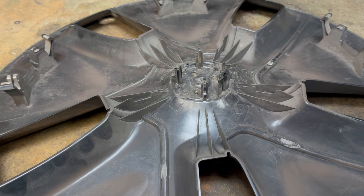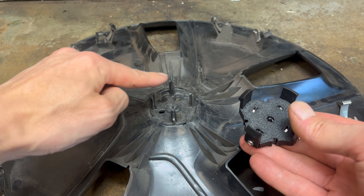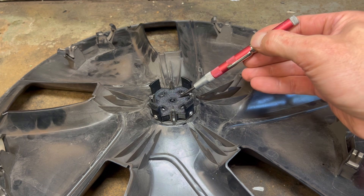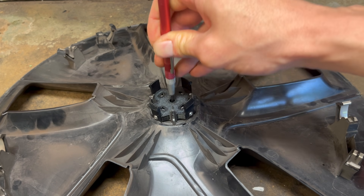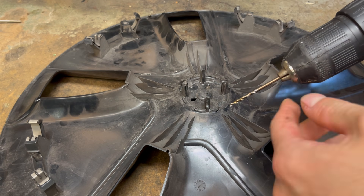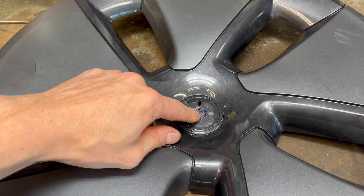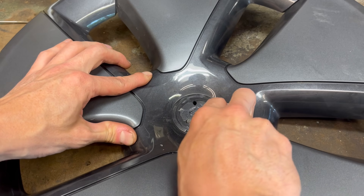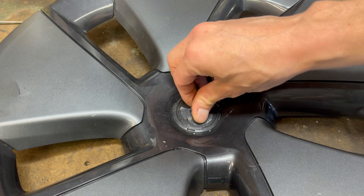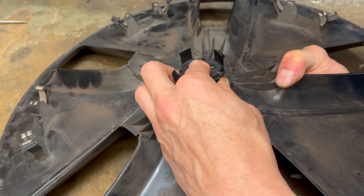If you have any tabs that are remaining, just go ahead and put them out of their misery and put it behind you. The little grooves on the side of these are meant to lock into these pieces here, so this whole thing can just slide on like that. I just have a punch here — mine's automatic, but you can use a screw or a nail — all we want to do is mark this center hole in the plastic so that we can drill a hole through here. That's the size of the M3 screw that's going to go through. I don't have any metric bits but an eighth-inch bit is close enough. I'm going to take a sharp knife and clean off the excess plastic. Then I can take one of the bolts and the fender washer and put that in, then flip it over and drop our 3D printed fitting on top.